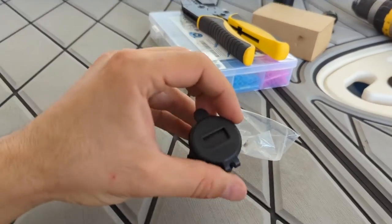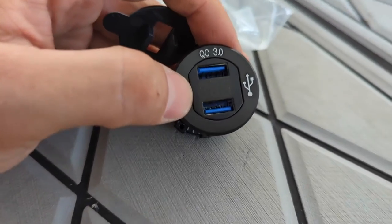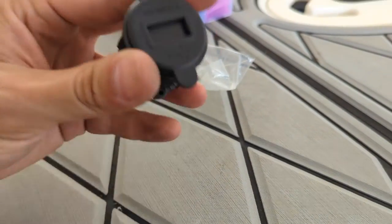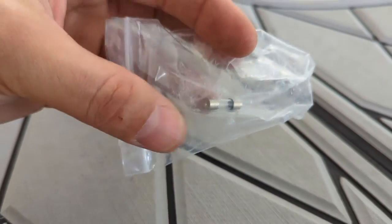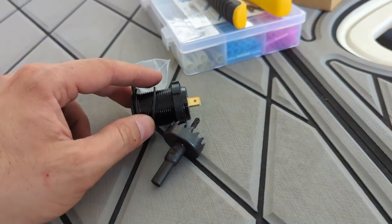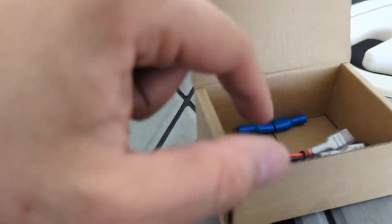What I'm going to be using is a Quick Charge 3.0 pair of USB ports. In the middle there are some digits — that's a voltage readout, so in addition to being a charging port, it also tells you the voltage of the batteries it's running off of, in this case the house batteries. It also comes with an extra fuse, a fuse already inside it, and a hole saw of the correct size to drill the hole for the shank to go through, plus a retaining nut for the back and a couple of wires with spade connectors to connect to your power source.